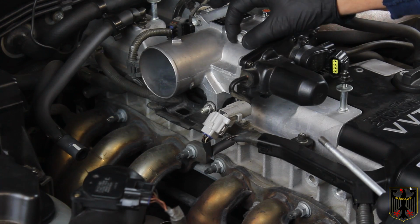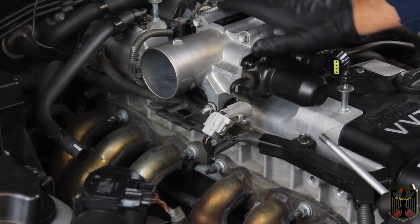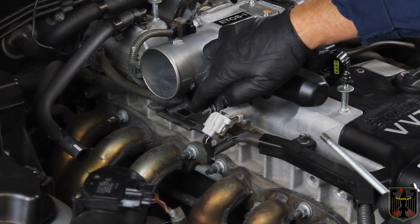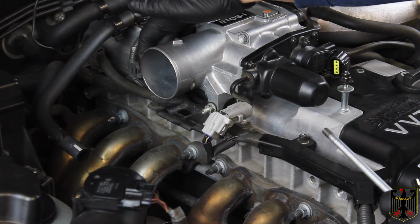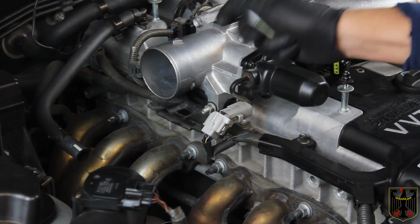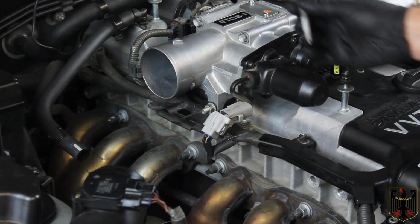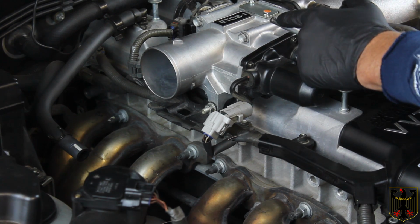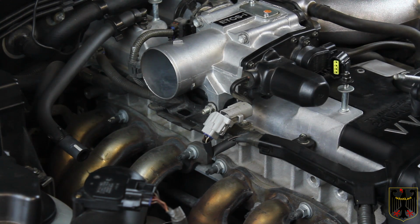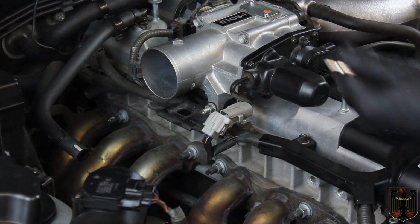I've loosened this bolt here, and because the body shakes while you loosen it, you want to have somebody hold it taut while you loosen these bolts. Then there are 2 nuts coming off studs down below, one here and one on the other side. There's also a long stud-type thing that goes through here with a nut on the end, and this takes an E7 type special socket to remove. We've pulled that loose, and we put a little bit of penetrating oil on the other side to make sure it would come off easily. Now I'm ready to take these bolts and the 2 nuts out, and then we'll see if we can get this out of the way enough to get to the spark plugs. If not, then we'll have to pull the water lines.